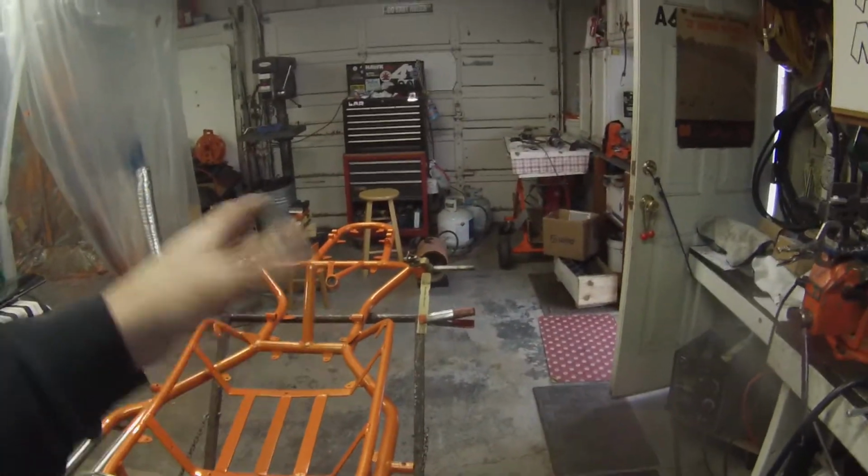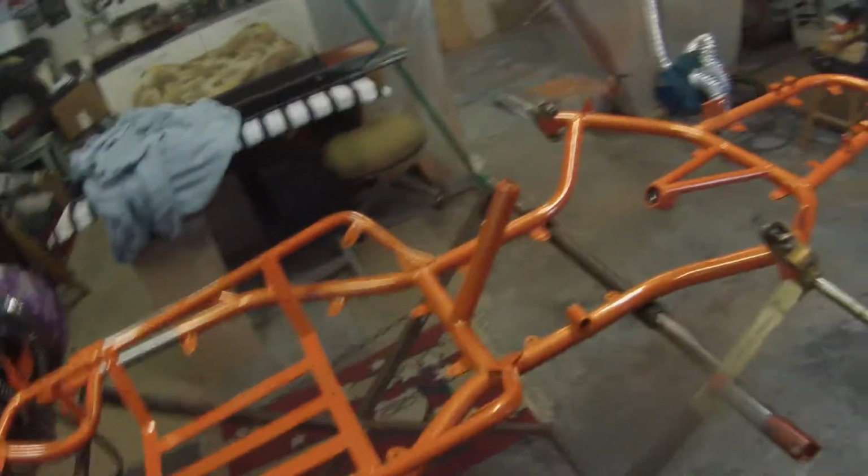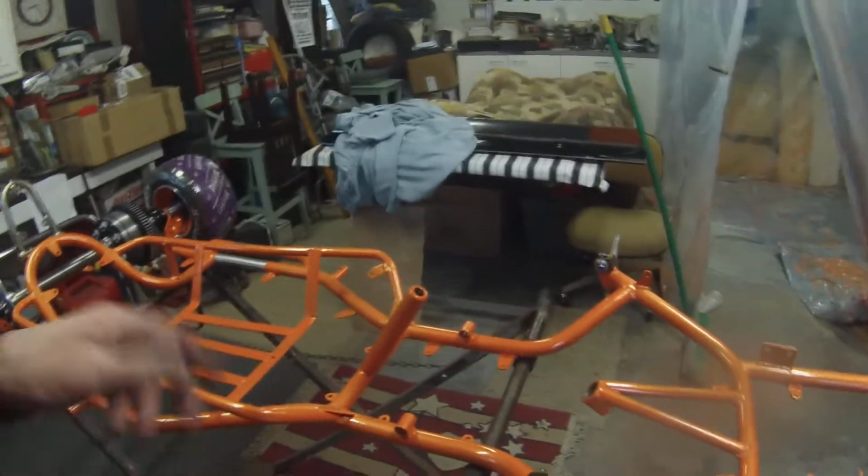Those stub axles literally get about 7/10 of a degree, almost a full degree of negative camber, where the top of the tires would be tilted in when Richie stood up. We put it on the floor and we blocked it up out here where this last bearing was running out here, up off the ground, and zeroed it out on the axle. We took settings, wrote everything down.